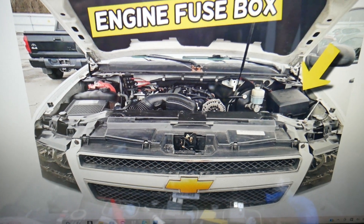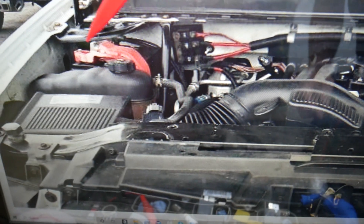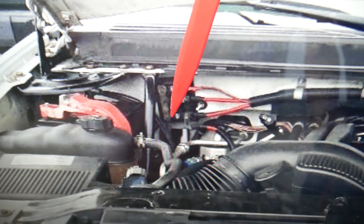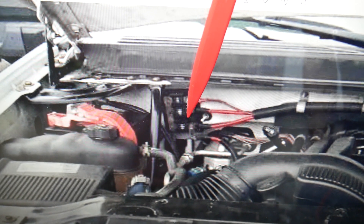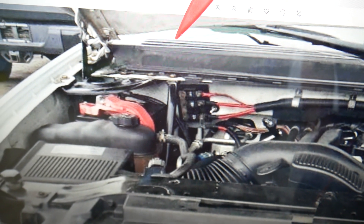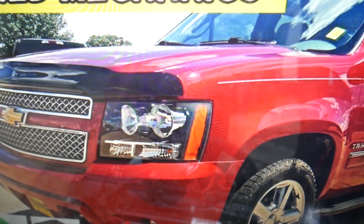So right here, if we zoom in — check out the car battery. On the firewall, you will have three fuses. That's where your alternator fuse will most likely be located. The mega fuse is the alternator fuse, but we recommend checking all three. It will usually be a 175-amp fuse, though there could be exceptions depending on the engine model.